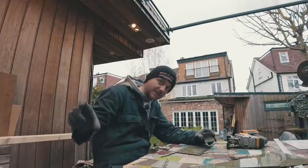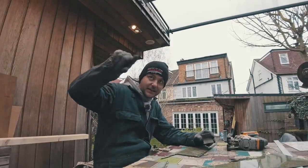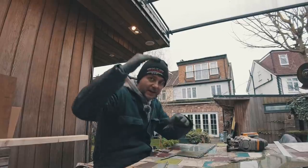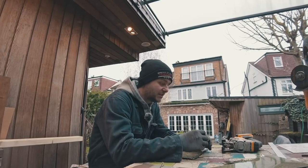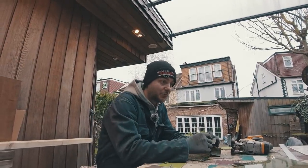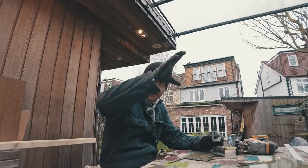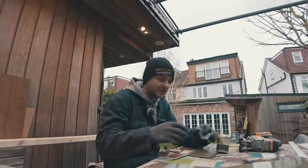Basically, the flow is in two layers. Boundary layer is the middle layer in between, then you have the attached flow, and then the high energy one. You want them all combined, so it's lots of energy. So what vortices do, they create a spiral vortex effect, which brings the high energy airflow into the boundary layer, mixes it all up, and keeps it attached.